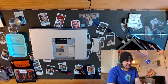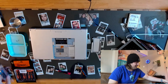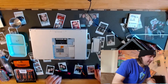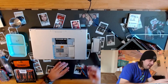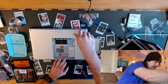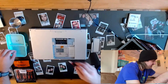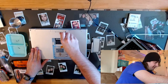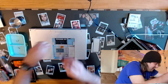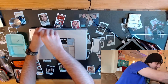So true. Okay, so these are like a T8 and a T10 that I use to fix my iMac. And then here's the spudger. So I'm going to need this to pop up some hooks coming up in a second. So now we go back to the Phillips, and these guys are some big screws right here. These are some really big ones because these are basically what's holding the whole keyboard assembly on.